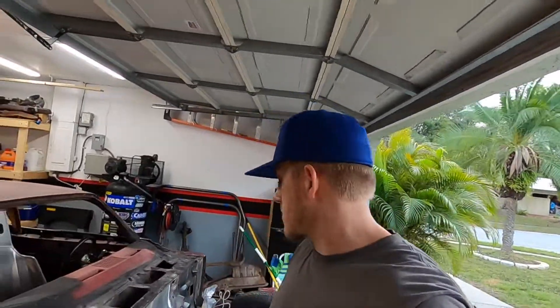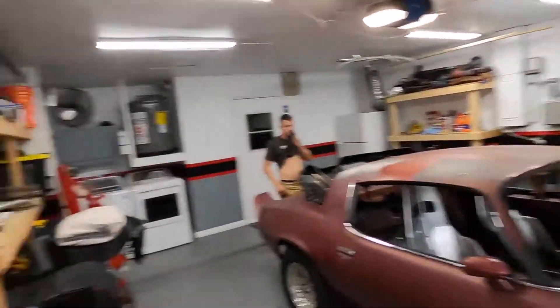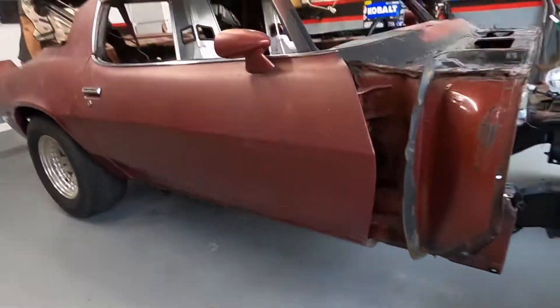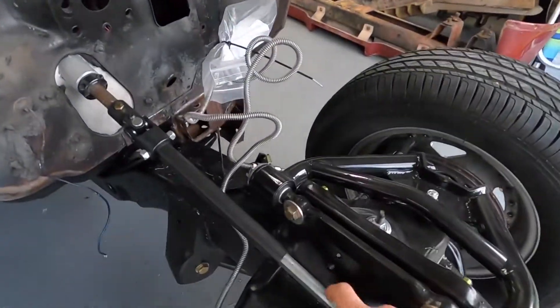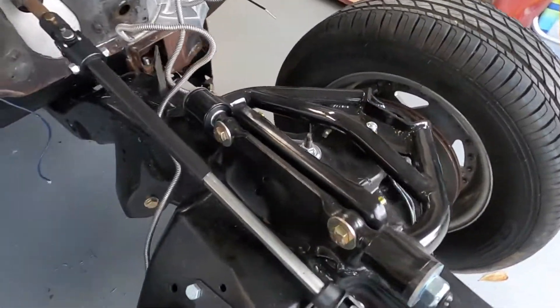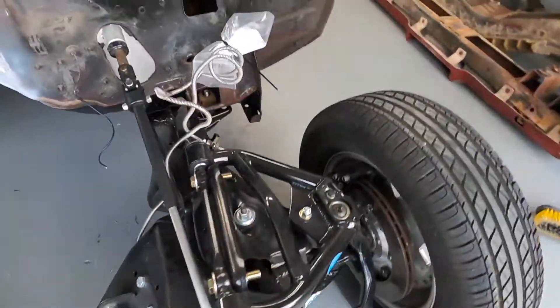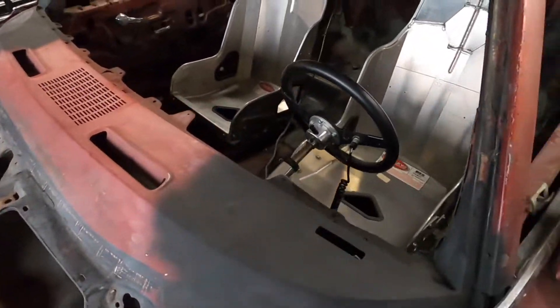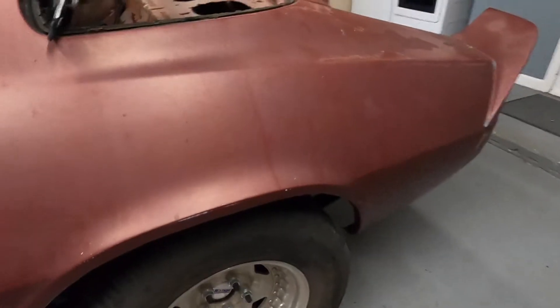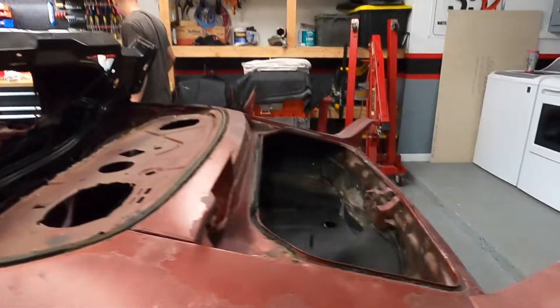The car is back on the ground. We got the rear end in, the subframe, and the subframe connectors. We also got our steering done - as you can see it is now a slip joint steering shaft, with a nice 3/8 bolt in there. We got everything done we wanted to do, and all the undercoating is done.